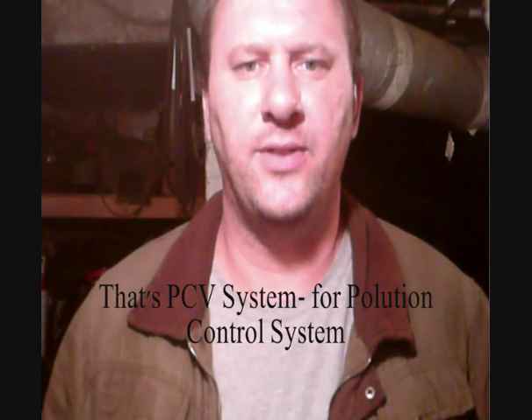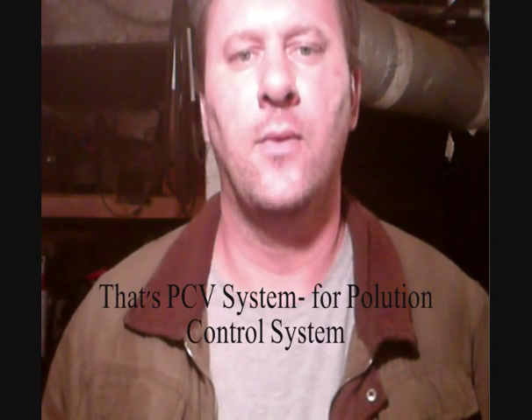Hey people, Frank Saman here doing a video on small engine modification. This topic will be about PCV systems, how to modify them to where you don't need a catch can. We guys race these motors and a situation arises where you get rid of the governor or you up the governor's speed and you have a problem with oil coming out of the PCV valve, which in turn dumps into the carburetor and gets sucked into the motor. The result is engine smoke plus loss of oil. I'm going to show you how to modify this system without using a catch can.